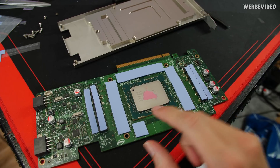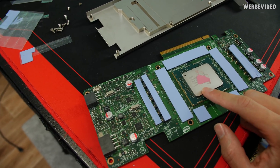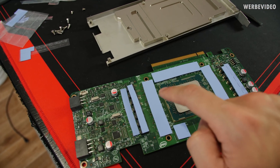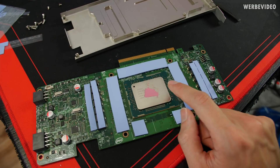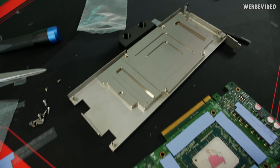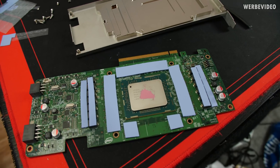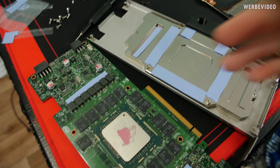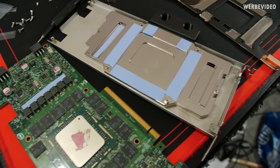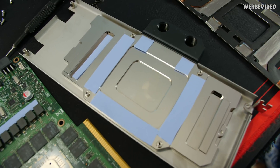That is the current state with the thermal pads and thermal paste. In case you're wondering why there's so little thermal paste - we're going to perform just a simple mounting pressure test first, to see if we can get a proper connection between the block and the inductors, power stages, memory chips, and eventually also the CPU. If you have no experience with a water block brand, just double-check to be sure everything is working and fitting fine. You can see there was contact between the inductors and the block, and also the memory chips and the block, but no thermal paste contact with the core and the block.